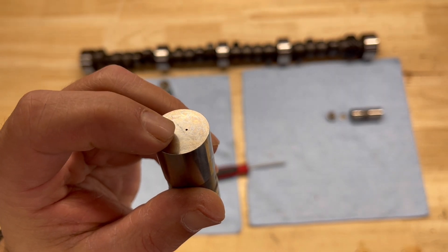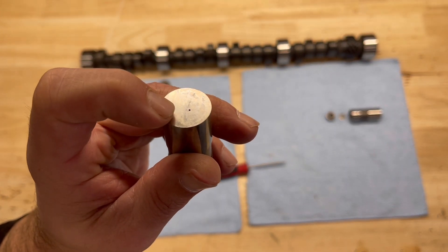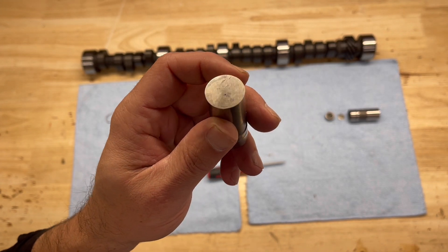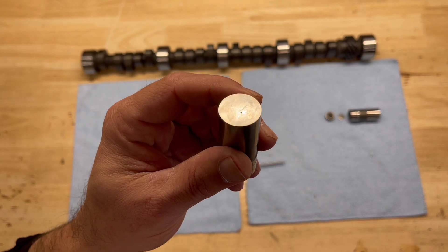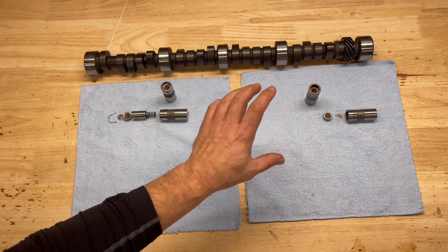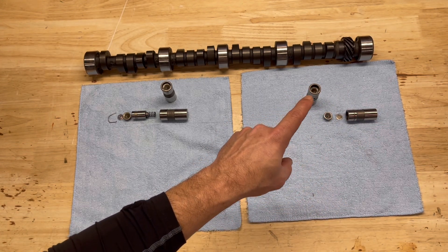You're probably wondering, why don't you just drill it? Well, this is hardened steel, and the machining process to put that tiny of a hole in it is very difficult, and in some cases it'll deform the tip. EDM is a manufacturing process used for putting different shapes in metal — it uses electricity to put that tiny little hole in there. Now we're going to discuss the basics of a traditional hydraulic lifter versus a solid lifter, and talk about what makes this EDM lifter so special.